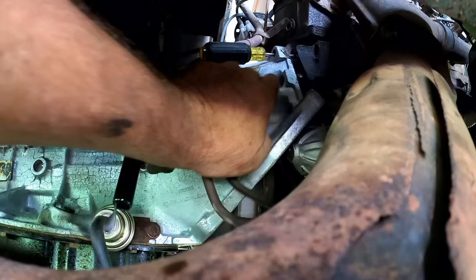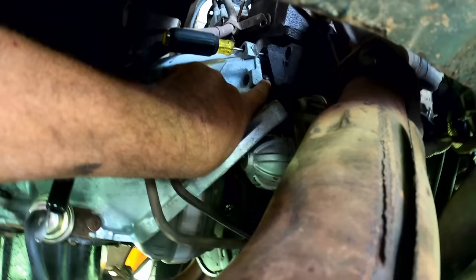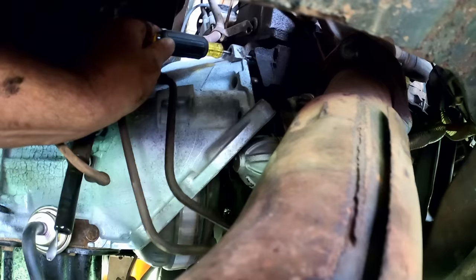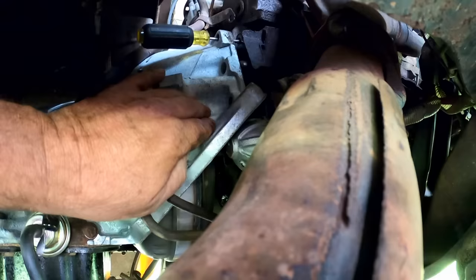You can see that. See, we're pretty close here. This is where the dowel pin is. Maybe you can't see that, especially with my finger in the way. The dowel pin there, and there's the hole where it lines up. And then above that, I got a screwdriver. Actually, that can help to put it through the transmission and into the bolt hole a little bit. And sometimes you just wiggle and jiggle it a little bit while pushing the transmission a little bit. And then you can get the next bolt, the neighboring bolt, started while you do that.